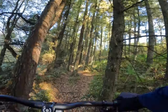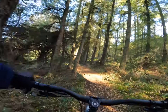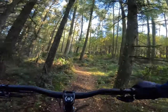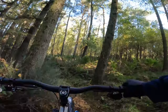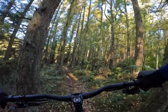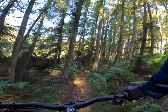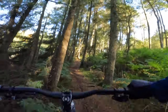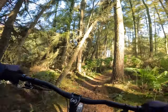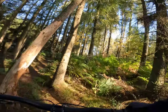That's before I've turned the tyres tubeless, because I think that'll be the ultimate way to go — not just tubeless, but with an insert as well, so you can drop the pressure down to about 15psi, whereas I'm currently running about 23psi. The top version comes standard with Hutchinson tyres, but whatever price you come in at, you've got the option to spec different tyres and different finishing kit when they build the bike for you, because all the bikes are still hand-built in Rotherham — they ship the frames in and create the bikes in-house.